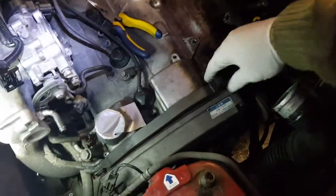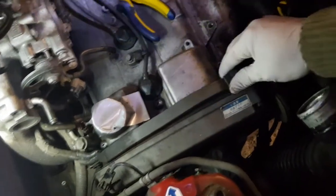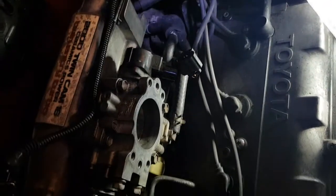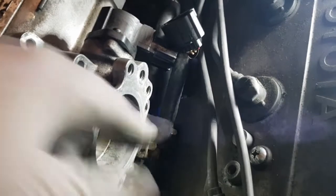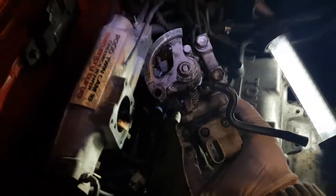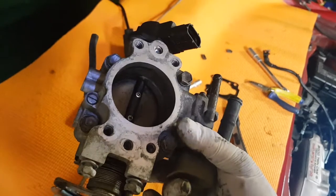When you've undone those things, there's normally two bolts on this but I don't have any bolts — this just comes off on mine. And then that's now loose, put to one side. Remove the black clip from there and then undo one, two, three, four bolts. When this is off, remove the remaining hoses. With all those hoses now removed, I can remove this throttle body. I put the small hose back on, the other hose I left on, and I put the four bolts back in.